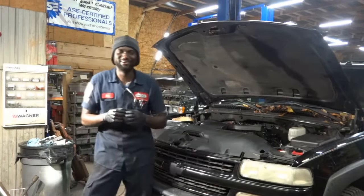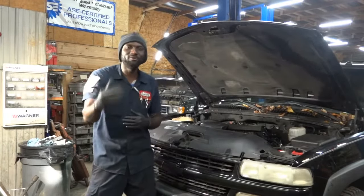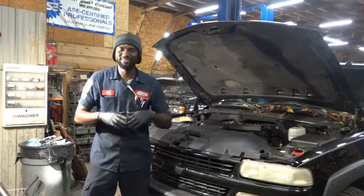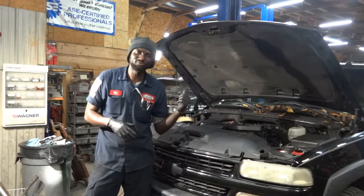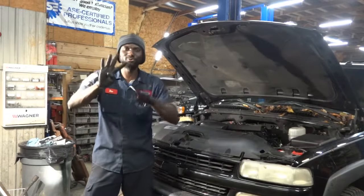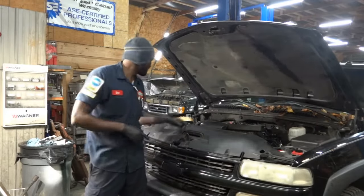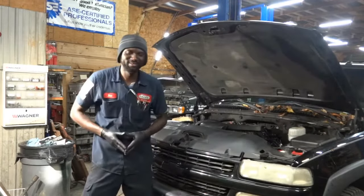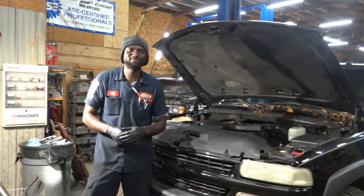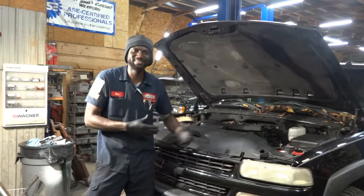This is interesting — all eight ignition coils have been replaced and the issue is still there. They went further and replaced all eight injectors, and the issue is still there. They also replaced four O2 sensors — the issue didn't disappear. Then they replaced the mass airflow sensor, and the issue still remained. That's when they quit. They said they were putting too many parts in this and it was starting to get expensive.